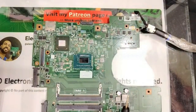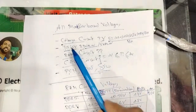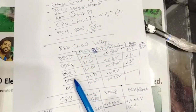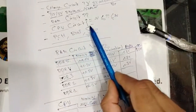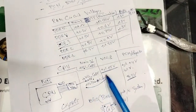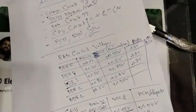We're going to respect our chart here - all motherboard voltages. We're going to check basically the charge circuit first, then the 3-volt and 5-volt circuit, then RAM circuit voltages. For RAM circuits we'll find out which kind of RAM circuit we have and then check those voltages. Then the CPU circuit - the VCC core - we're going to check the VCC core and the VCCP, which ranges between 0.7V and 1.2V. Then we'll check the PCH, the BIOS, and the SIO. We have about 15-20 minutes.